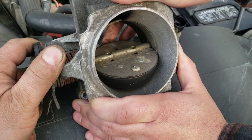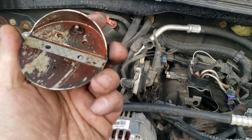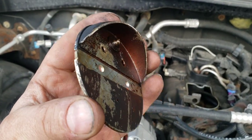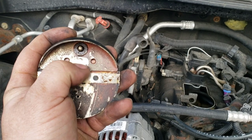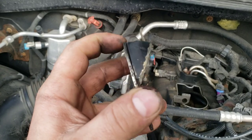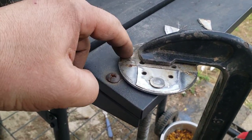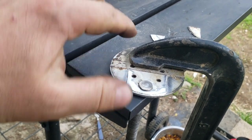After you slide it out, that's what you've got — it's real light aluminum, so it won't be too difficult to cut through. I'm going to leave that small elevated lip there so those rivets stay in place as discussed — I'm cutting the face of the restriction off but not touching that lip. There'll just be about a millimeter or two left from the plate where the rivets go through, and I'll round the edges with a Dremel. Be real careful because the aluminum is thin and very quick to cut through — that's why I have the C-clamp holding it.